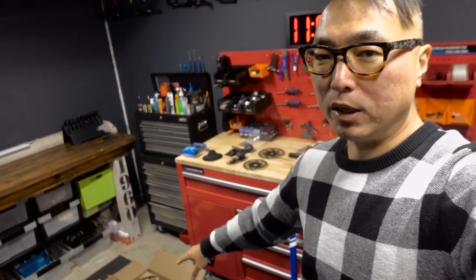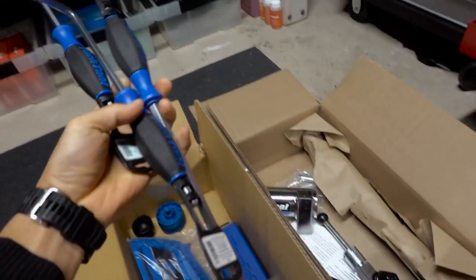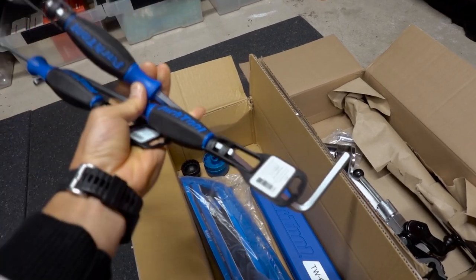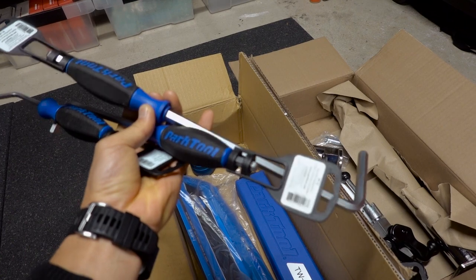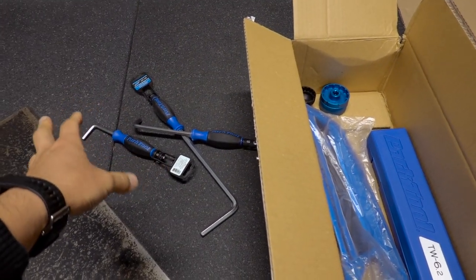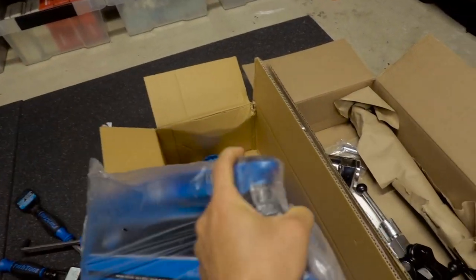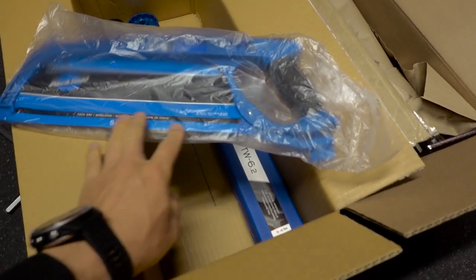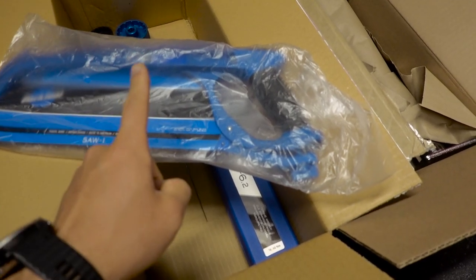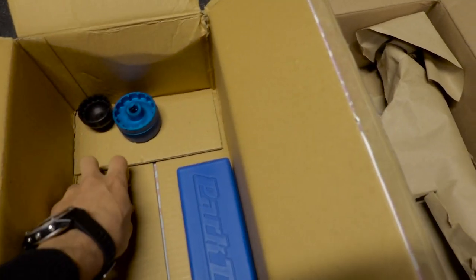Let me show you the tools I bought recently — this is only part one, with part two and part three coming, so stay tuned. First up, I ordered some Park Tool items: these are the 6mm, 8mm, and 10mm really long leverage wrenches — great for pedals and crank removal and installation with big leverage. This is for quick fixes. My old carbon saw was worn out so I ordered a new one. The good thing about the new Park Tool carbon saw is there's a little lever to tighten the blade tension — making sure the blade has enough tension is the number one mistake a lot of home mechanics make, and it actually makes a big difference.